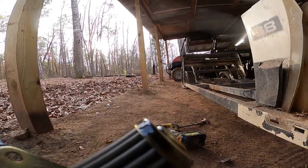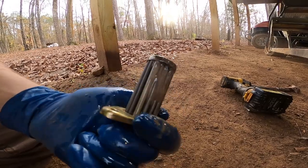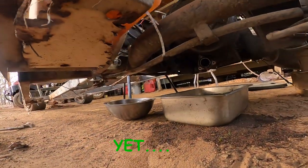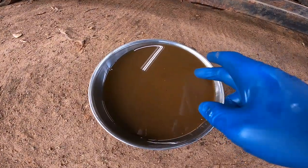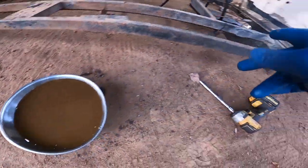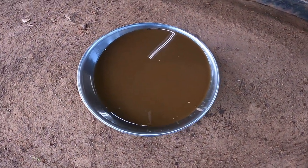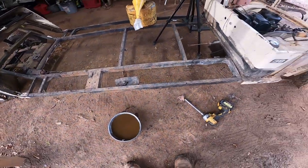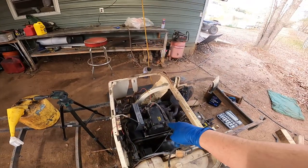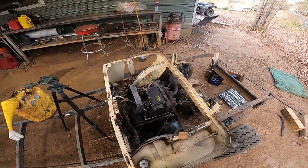Check out this screen. At least there's no metal on it. I'm glad I checked. Not off to the best start — that is full of gas. And then I got a whole other pan under there too with a little bit of oil and then some water in it. So not the best start. I'm going to go ahead and take some diesel and flush all that out, and maybe that will clean it out a little bit.